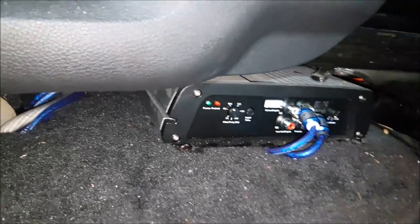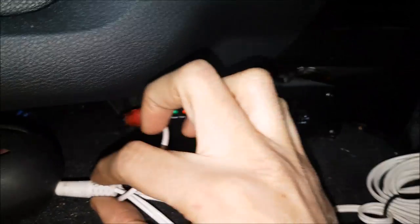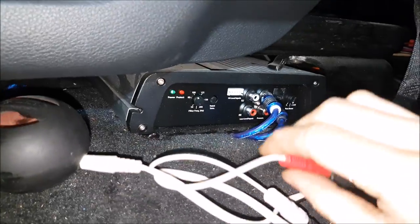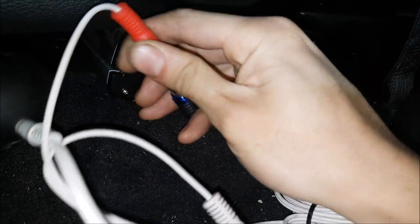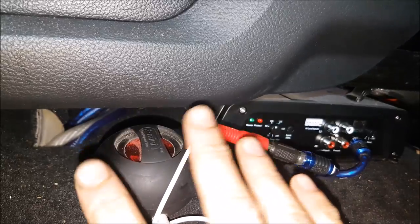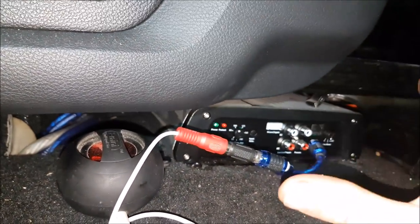What we do is take the RCAs out and use this mini speaker — it's just a generic mini speaker people typically use to plug in their phones. We use a 3.5mm mini jack with a Y cable on the end, typically used for home theater applications. We put a barrel connector on and then attach it to our RCAs, feeding both in even though we're just getting a subwoofer signal. You'd attach both ends and listen to the speaker. If you're getting a bass signal or some sort of audio signal, you know you're okay — the RCA is not cut or pinched, the head unit output is working properly, so you don't need to look at anything under the dash. You can now focus on the amplifier.